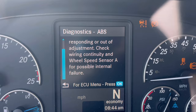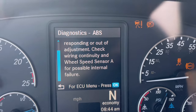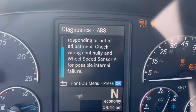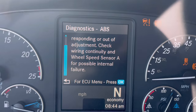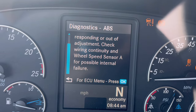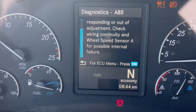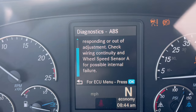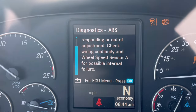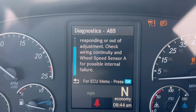The way the sensors are positioned: you start from the steer tire on the driver side, then go to the steer tire on the passenger side, then go to the middle axle drive tire on the driver side, then across to the same axle on the passenger side — that goes A, B, C, D, E, F. That's the way they are positioned.